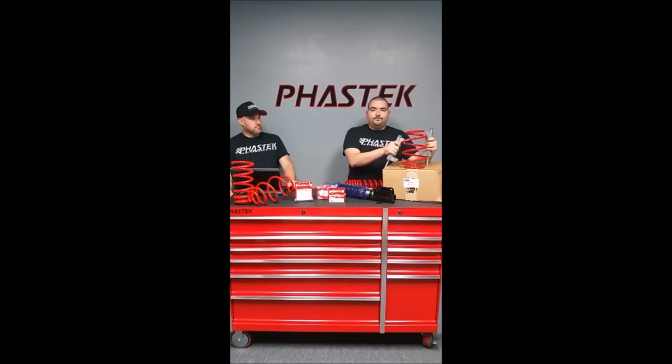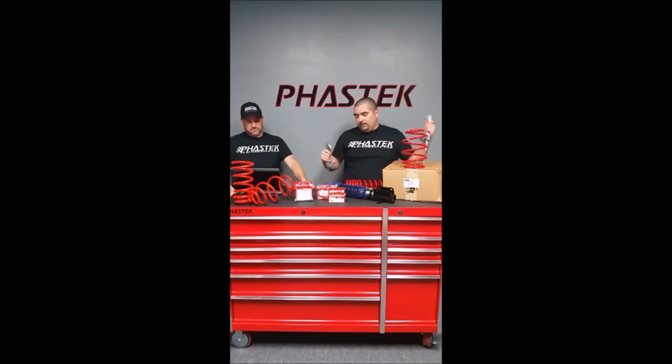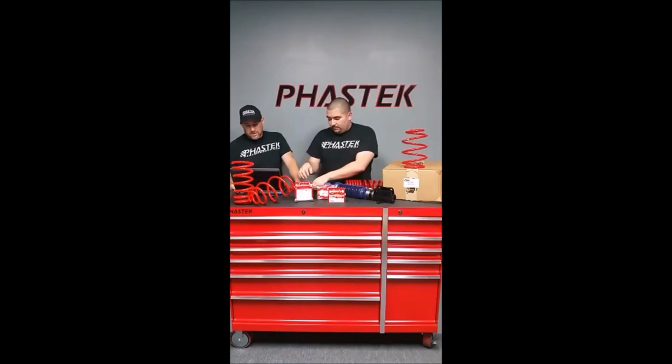All it does is really kind of compress the spring, so that's why it takes a little bit of pressure off the strut. And then when you take that center bolt out, it's not going flying anywhere. So let's answer a couple questions here.